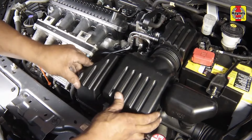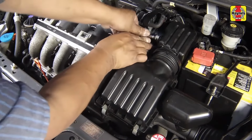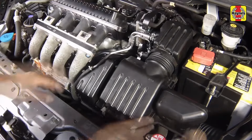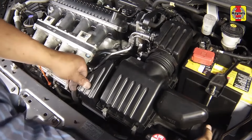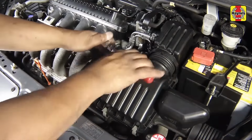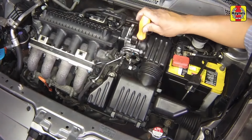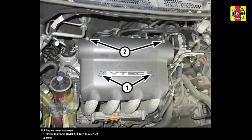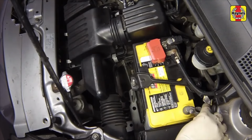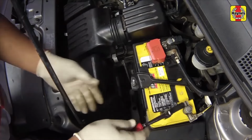Connect the intake port onto the throttle body. Then the breather hose, followed by the intake air temperature sensor at the rear. Connect the fresh air inlet duct, then install the housing mounting bolts. Tighten the bolts securely. Tighten the hose clamp and throttle body securely. Install the engine cover. Connect the negative battery cable to the terminal and tighten the cable clamp nut securely.